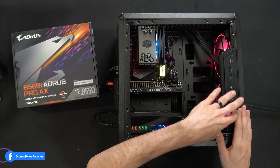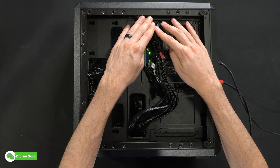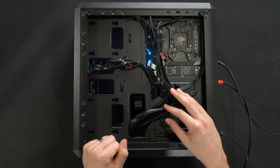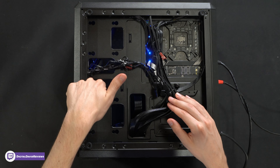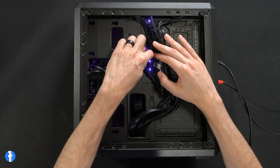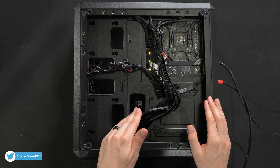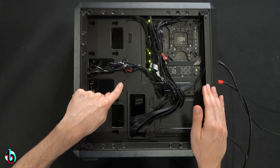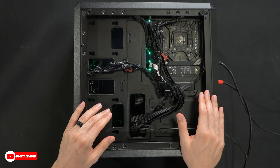Keep in mind to configure your build accordingly to how you want to place your power button and front panel. Looking at the back side, you can see our cable management — everything routed up at the top along the center and then coming back in down at the bottom, same with our fans connected in the center. Off to the side we have different channels and ways to route cables to the front and back. We were able to sneak a lot of our connectors through here, including USB 3, front panel connectors, HD audio, and CPU power. There's plenty of zip tie and tie-down points.